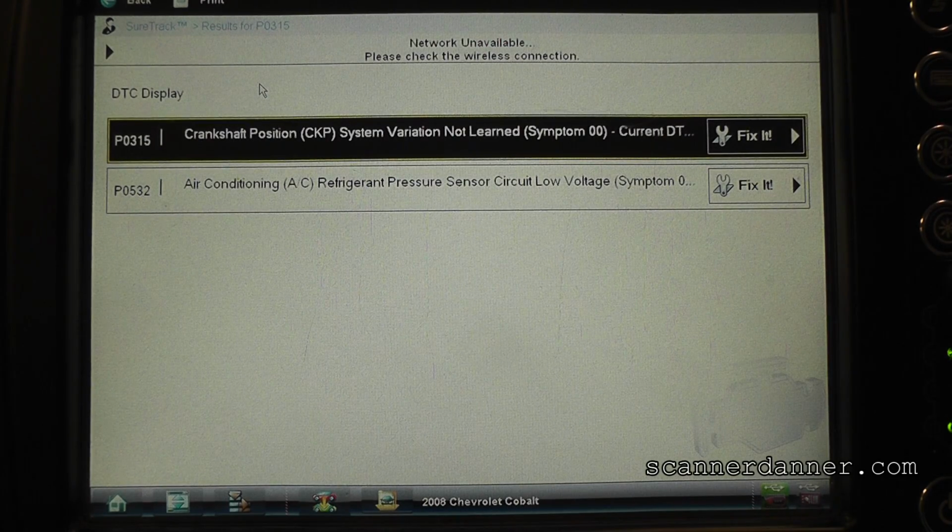Go ahead. Got a tach that's working now? Yep, so the tachometer is now working. So what's different with this system? It almost was like without it seeing that crank signal, it's keeping that in a default mode, which is 0. Does that make sense? This happens with computers. You see a fault in a system, certain things are shut down and ignored. It's running in a default mode. So it wasn't recognizing that crank.